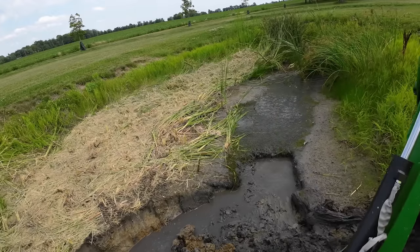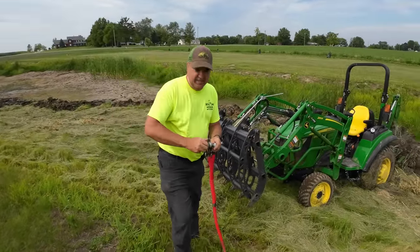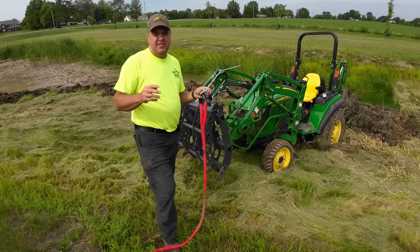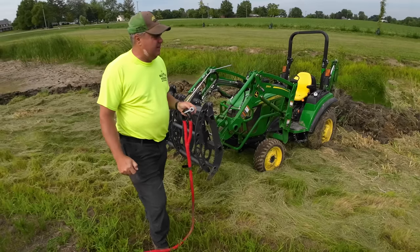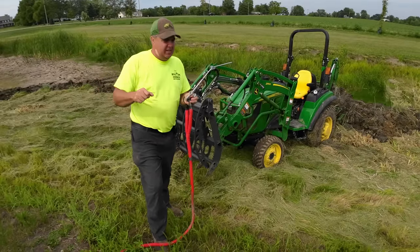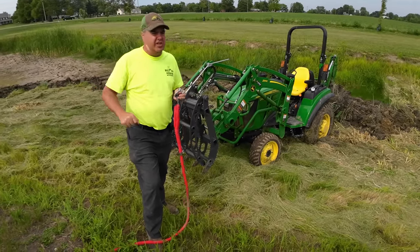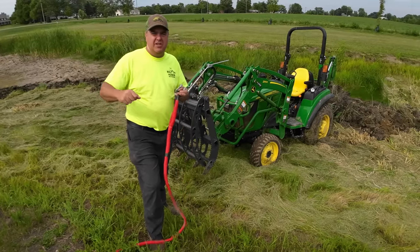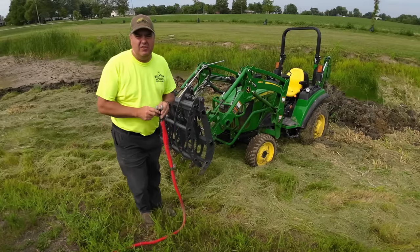Kind of anticlimactic. Well, the Yankum rope is getting a little more practice than what I'd like it to. Yeah, I'm liking this thing though. I'm used to using chains. You've seen on this channel, we've always used chains. The Yankum just makes a more gentle pull, right? When I pull it tight, I don't have to be as careful about not jerking it. And even then, it stretches a little bit before it actually starts to pull. So I'm pretty impressed with this. I think I'm a convert.